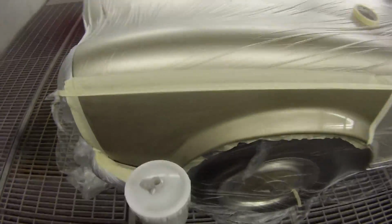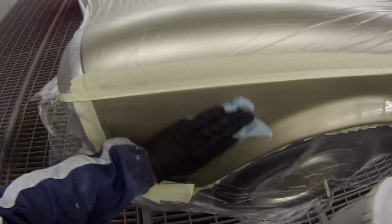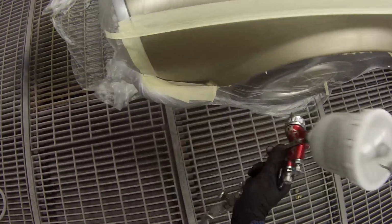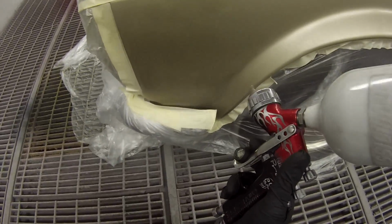So this is that area. You can't probably barely even see it in the light in this booth, but just there where my hand is now, it's got a slight cut through, and we decided we'd just fix it. So I did a quick scotch down, used a bit of 800 pad and then scotched over the edge. Just gave it a quick mask up again, and then splashed a small amount of colour just over that front area. It was just there that it was.